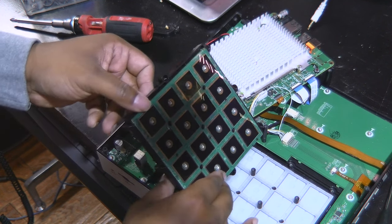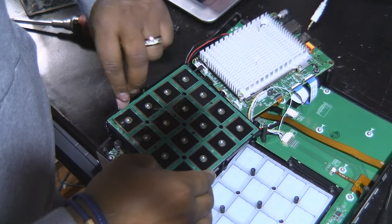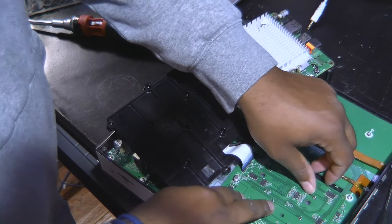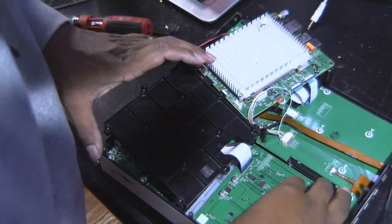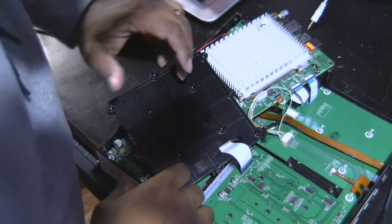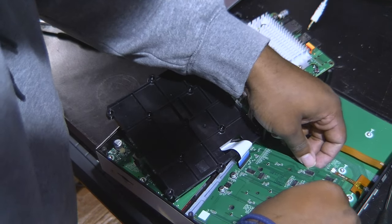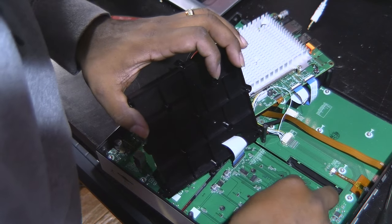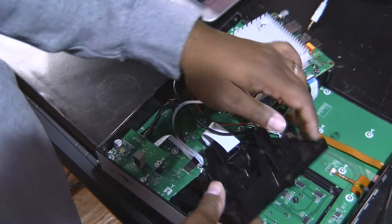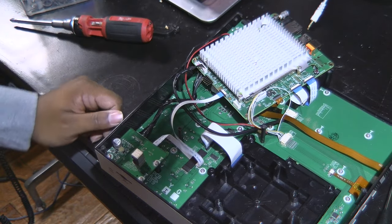When you're putting this back in — these are my new pads — put your pads in and make sure they're lined up. Shiny face towards the pads, make sure they line up. Put your new pads in. Take this, put it back, line it up with the holes. Be very gentle — you don't want to scratch them up or break them. Bolt it back on again. Got the pads in — let's close everything.